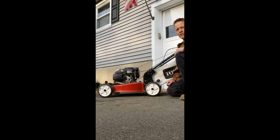Well, this happens more than ever now because of the ethanol fuel, the alcohol in the fuel, and it really destroys the little carburetors, the ones that are like this big, like in the string trimmers and things. A lot of times I don't even bother trying to mess with those carburetors, the orifices are so small. But normally it happens on things like this that sit for the off season. You go to start it, you knew that it ran, but now it's not running anymore.